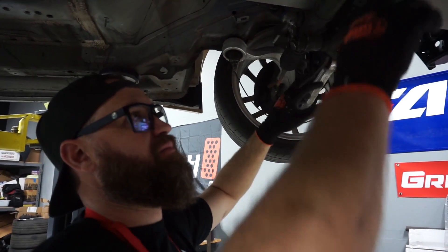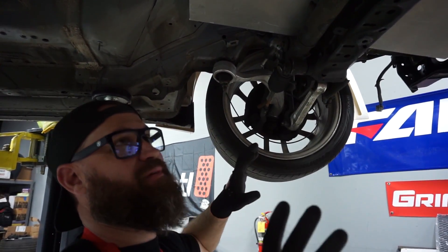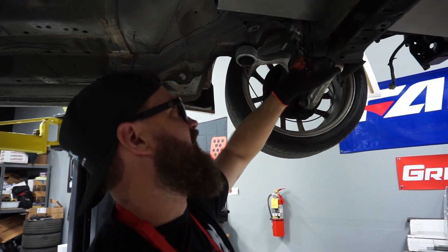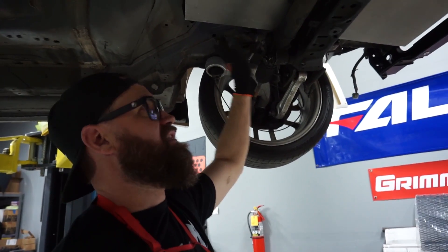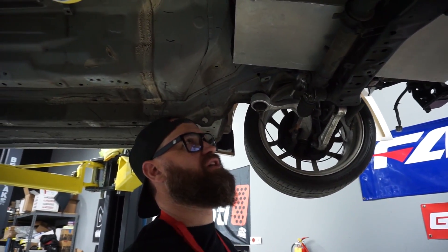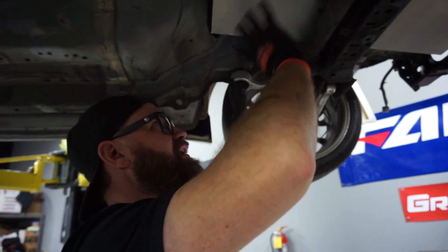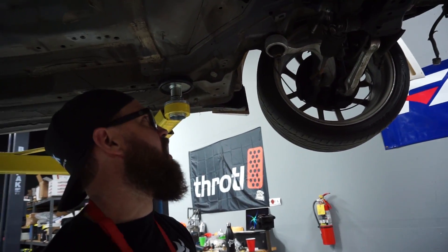However, the rack will have a little bit of play because it is not hard mounted. Because this is a common car to use for drifting, they do make solid aluminum spacer mounts — solid inserts for this — so we could put the solid ones in. It's going to give you a more direct feel in the car, maybe not as comfortable driving over the road, but for our purposes we might want to do that. That way this doesn't move very much, we don't have any issues with anything rubbing and vibrating. It's a good solution.